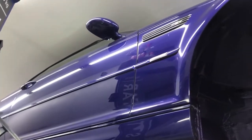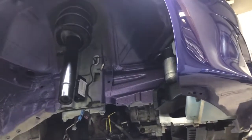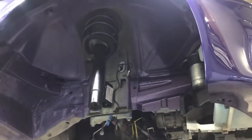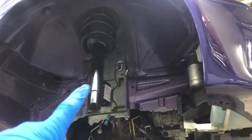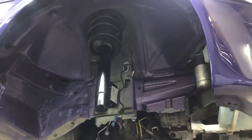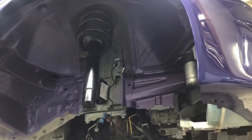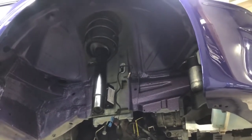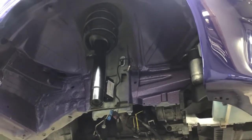Now we've done the unmasking and looking in the wheel arches, we can see that the body coloured overspray, which is velvet blue, has been applied before the suspension went in and the brake pipes and the little wiring boxes went on. We've done that as one of the first things, pretty much as part of the final stages of paint colouring and during the waxing process.